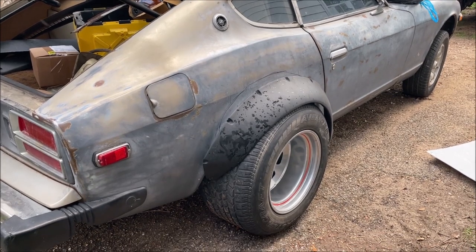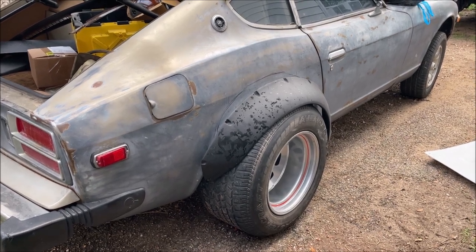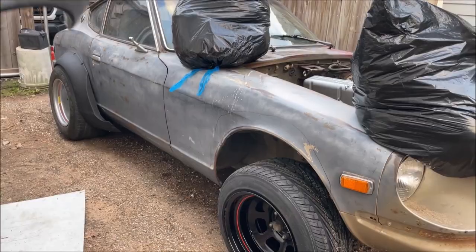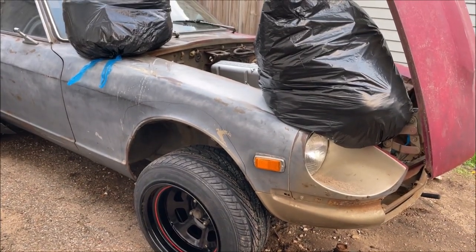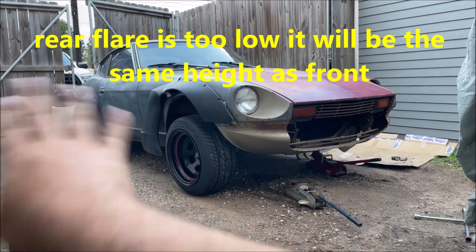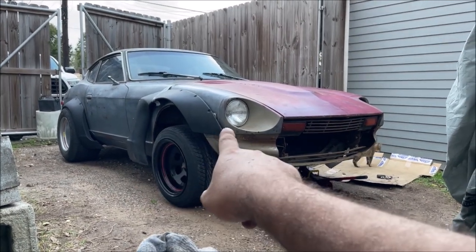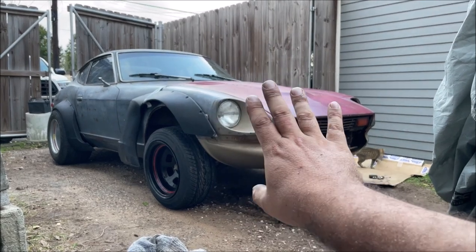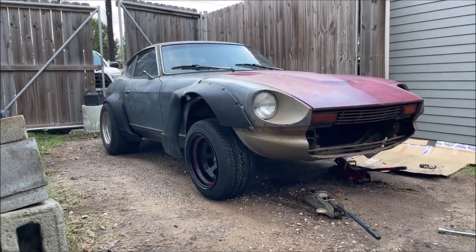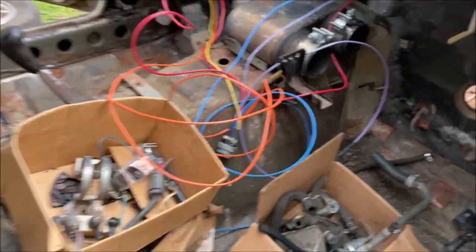I think I'm going to end up leaving that tire on it. Whenever we lower it the tire is going to tuck in a little bit and look a lot better. I know it looks like some redneck crap but these are not the final wheels. It looks like it needs to be lowered six or seven inches on the front. The back is fine — we can always put a smaller tire. The front is where we're going to start cutting; this fender has a dent and a little rust hole. We're going to take the spring out of that strut and experiment with lowering the front, cutting the fender out. Next video I'm going to wide body it — it's going to look very cool.